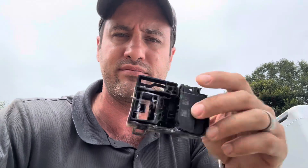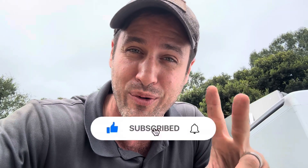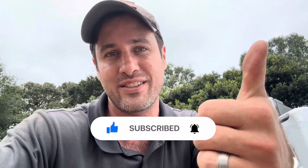1995 — new coupler, fixed and done. That was just a quick lid switch change on these GEs. Your data sheet is down there so you can test your stuff. I don't even pop the lids up anymore to change them — I just reach in, unslip it, plug it in, clear the codes, and you're back in business. Thanks for watching. We're almost to 600 — leave me a like and subscribe to the channel. Thanks y'all, have a great day.